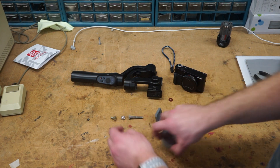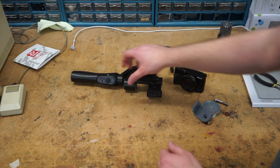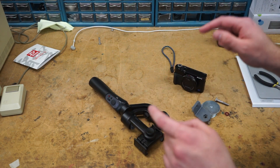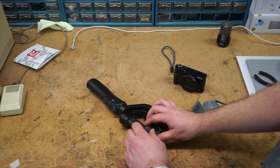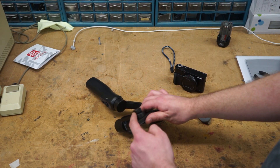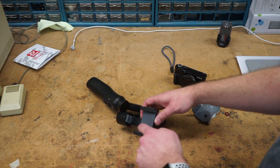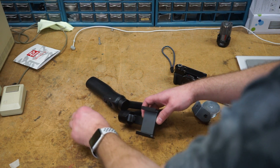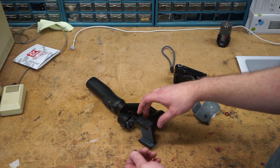The first thing you have to do is take apart your camera gimbal. I'll try to link a video in the description on how I figured out how to do this. It would seem that you could just unscrew this screw here, but not quite. You actually need to peel off this rubber sticker. When you get underneath, you'll notice there are two Phillips screws. Just take those out and you can pull the clamp off.